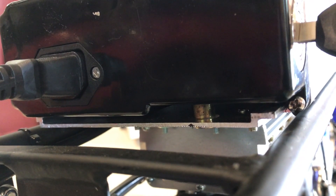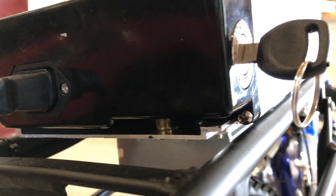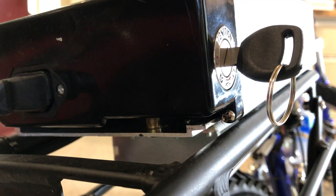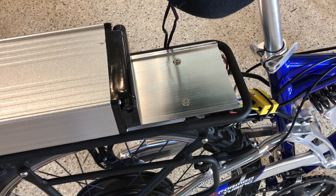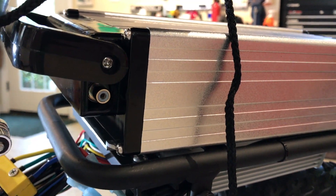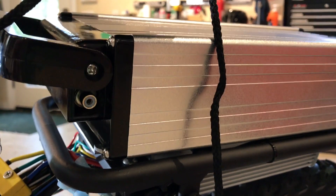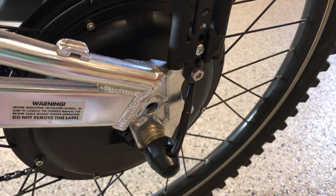The battery itself locks into place with a keyed pin that interlocks with the metal tray, preventing the battery from being removed. While not indestructible, it largely prevents the need to otherwise lock up your expensive battery. The tray mount supplied with the battery works nicely — the battery has a receiver for the tray rails and slides into position easily. Once removed, the handle flips up for easy carrying. The charge port is located under the flip handle on the side of the battery, so you do not need to remove the battery in order to charge it. This is the extent of the wiring to the main motor: a single cable bundle that I secured to the rack rail.